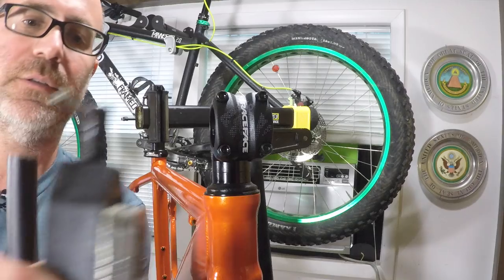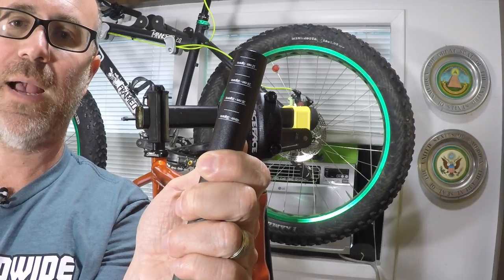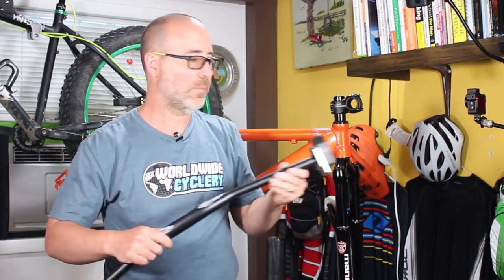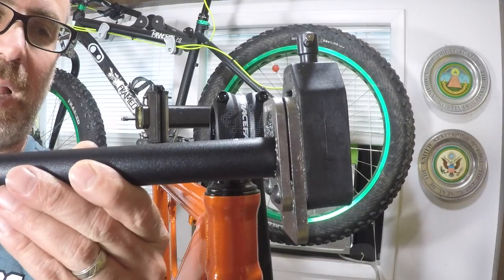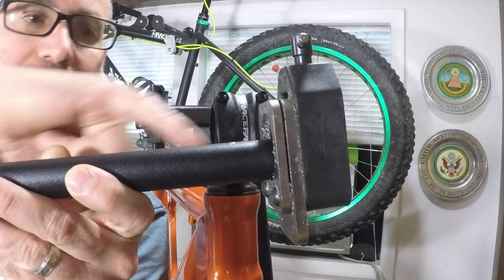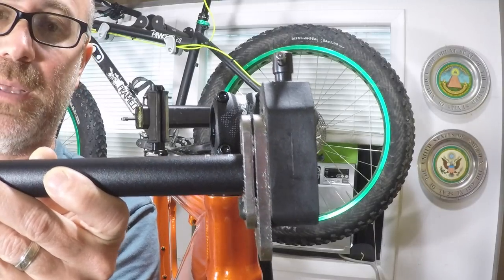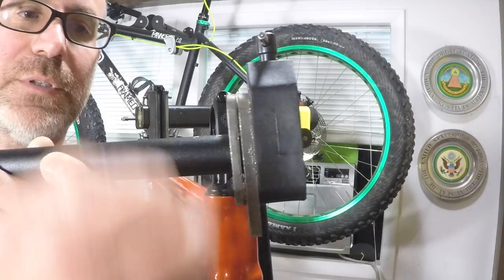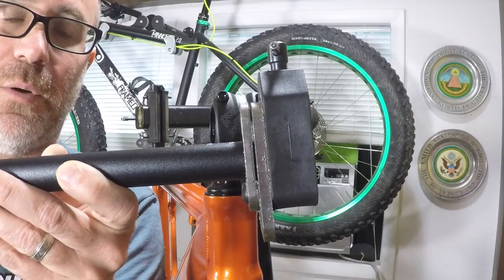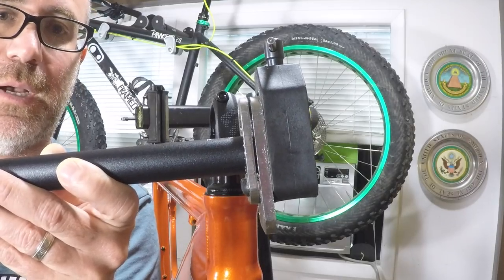This guide has a slot in it — you'll see the slot right here. You line that up with whatever line you want to cut on the handlebar and you use your hacksaw — that's how you cut. I have the handlebars now mounted inside of this saw guide. I've picked the 24 millimeter line. The saw blade would go through here and you'd cut down and trim off your handlebars. I'm not going to cut it right now because I haven't even tried the bike yet with the bars and I don't know what width I want. It's just a good idea to have this tool to do a clean cut on your handlebars.